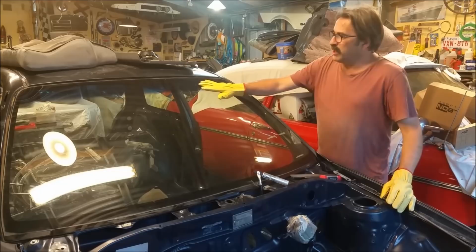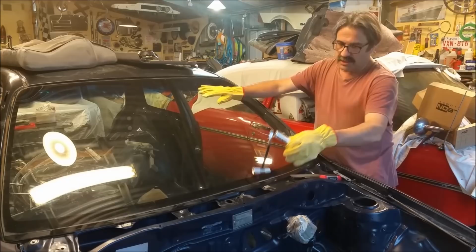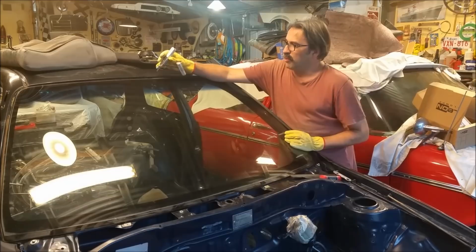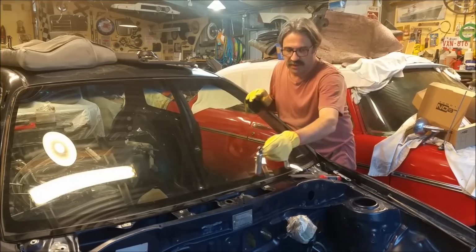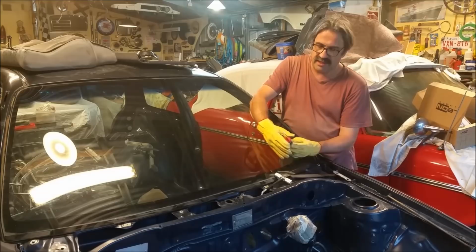I'm nearly there now. A couple of things. I tried this, and these are quite effective, but perhaps more effective with the old bonded screens, where you turn that and then you use the handle to pull on, which I've got the right way to get the picture. This wouldn't even penetrate the urethane. It's got a stack of urethane in it. So then went for this boot knife. That's from local hardware. It's got quite a thick blade, so it doesn't flex to get up under.